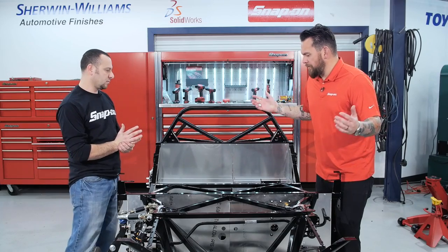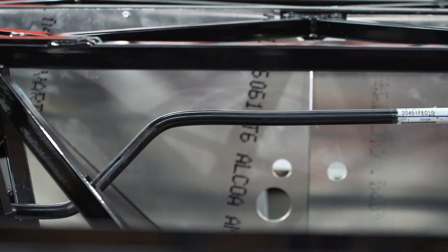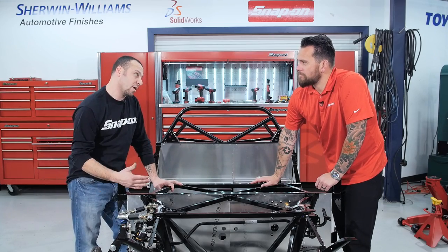Moving along on the vehicle, there's a notable part number visible. A lot of parts are sourced from the donor car rather than purchased new. The piece is actually the rear sway bar of a WRX being used in the front position — because the WRX's front sway bar is too large in diameter and not the right width for the weight of the car, while the rear sway bar is the correct diameter.